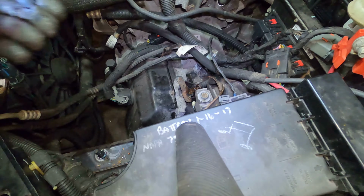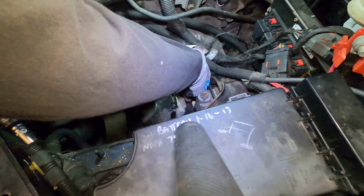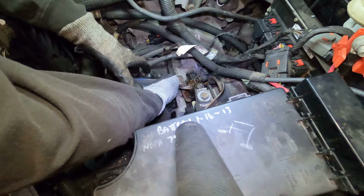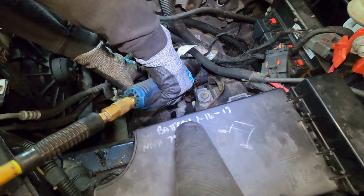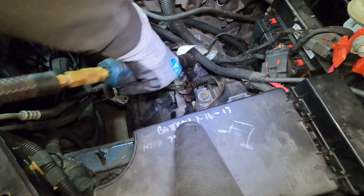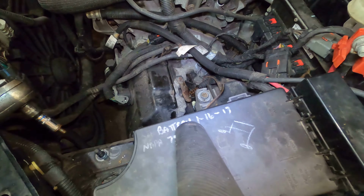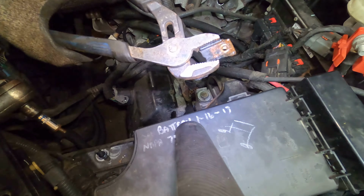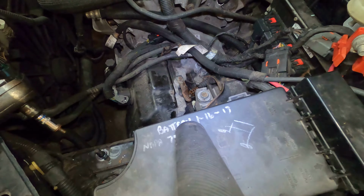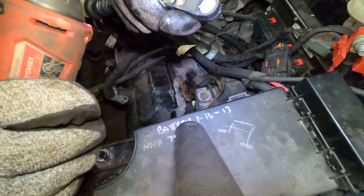It's very rusted. I'm gonna break out something stronger. Here's what that is. I see I grabbed it with the pliers because when I switched to the air tools, it's a lot more power, but you know, I don't want it to rip and jerk. So now what we're going to do is we're going to take the 10 millimeter, remove that bolt like so.